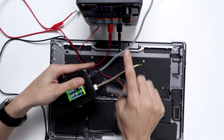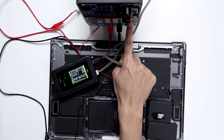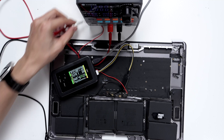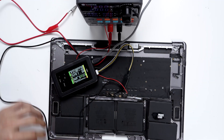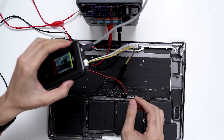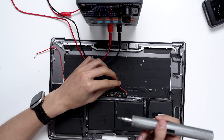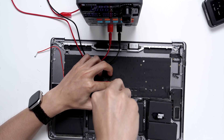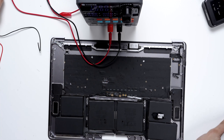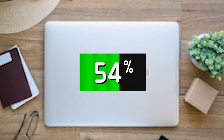For some models, it's recommended to continue charging up to 5%. After that, stop the output from the power supply. Disconnect the positive and negative alligator clips and the test cable from the battery's BMS engineering port. Unscrew and remove the external battery connector. You've now successfully brought this battery back to life. This method can apply to all MacBook batteries that find themselves with this issue. Let me know if you have any questions in the comments below. Thanks for watching!